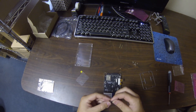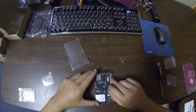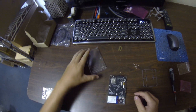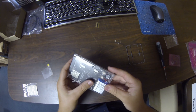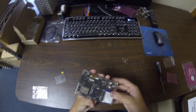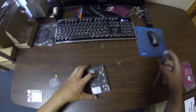Now we're going to take and put the on/off switch on here. The next thing we're going to do is insert the ribbon cable into the board and then pop the little tabs down on this to make sure it is nice and secure. Then we're going to go ahead and pop the back of the case on and screw it all in.